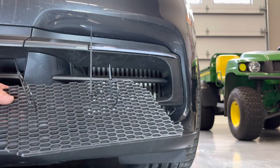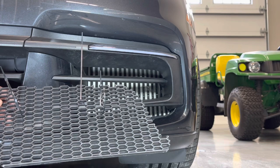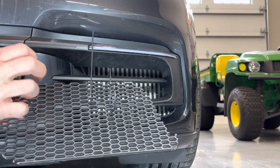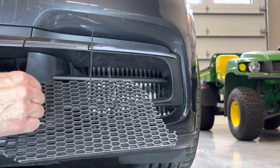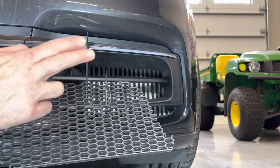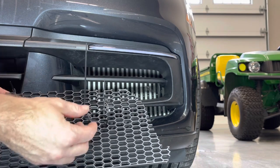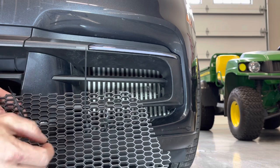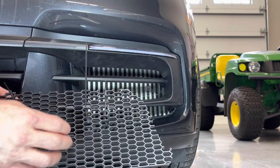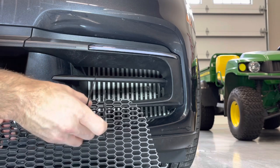This is the driver's side grille. Notice the protrusion towards the right. This grille has three cable ties installed — two loops are used to grip and maneuver the grille into place. They will be cut off after the install. The third cable tie secures the grille into place. Make sure it stays in place during the install and check on it periodically to make sure it hasn't moved or started sliding towards the back — just give it a nice tug to keep it in front.